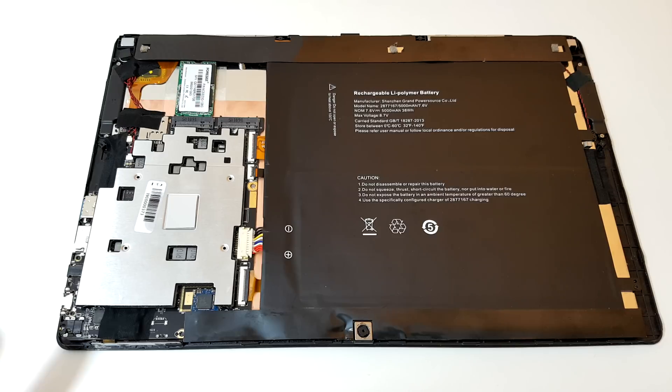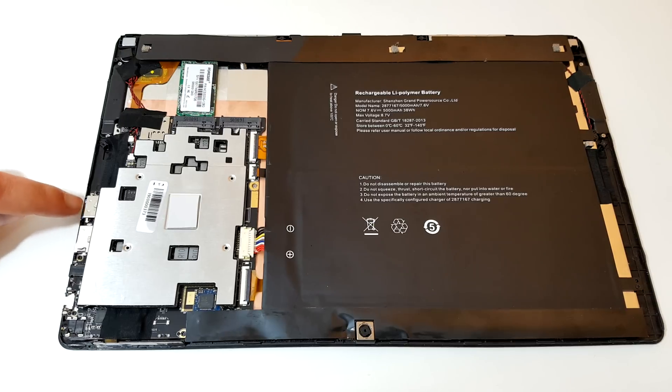Unfortunately my unit is dead. I'm highly annoyed at my own stupidity for going into that menu, and also annoyed that there was no secondary menu and no fail-safes — it just went ahead and flashed. What I was trying to do was update the BIOS to fix the microSD card issue, because I can't use any of my 64 gigabyte microSD cards. I found a BIOS on the Cube forums newer than my current one and loaded it onto a FAT32-formatted flash drive in the USB 3 port, but it wiped the BIOS and killed my tablet. Learn from my expensive mistake.